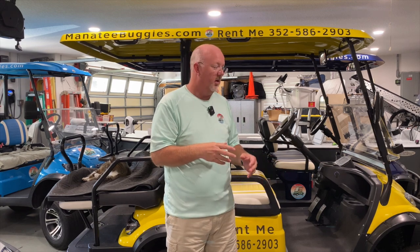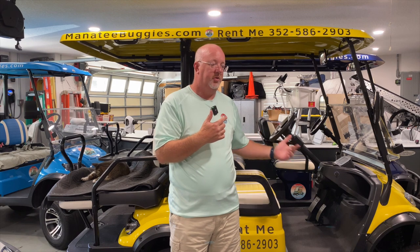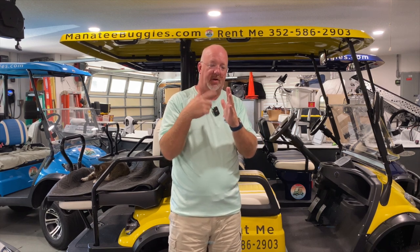On these, when there's no power attached to them, they are in the closed mode where they hold the cart in place. So when you let off the pedal, you'll hear a click or a clunk, and that's the unit going back together, and basically that's your parking brake. Subsequently also, whenever you tip into the throttle, you put voltage to the electromagnetic ring inside there, and it opens and allows the disc to spin.